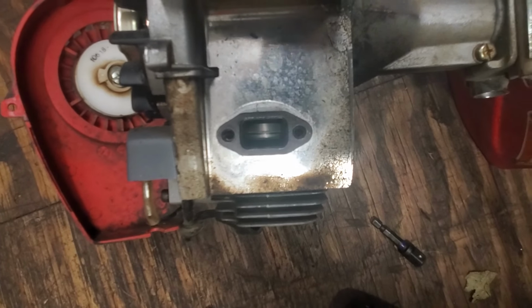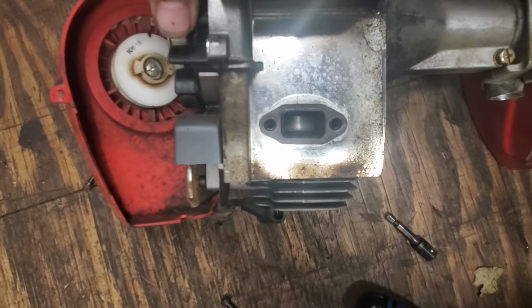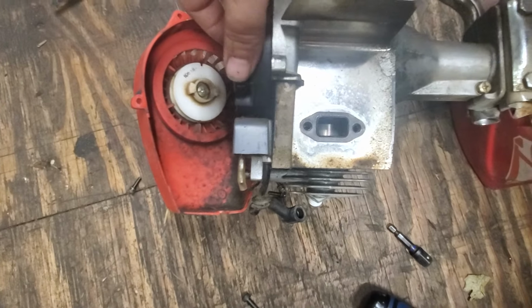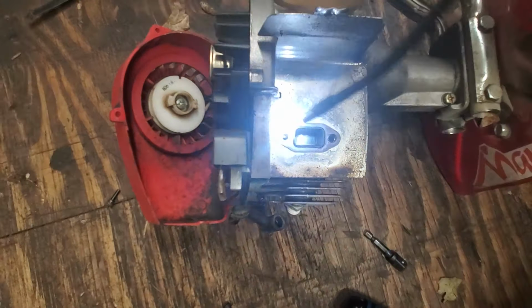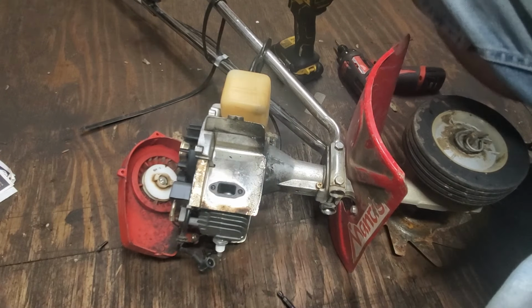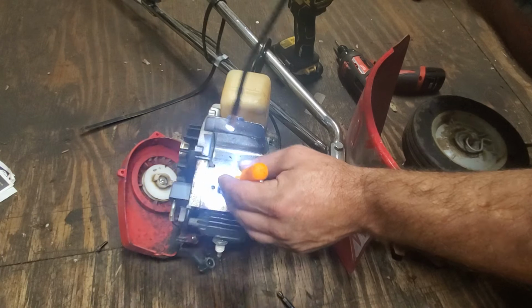Here's our piston. Okay. Let's turn this a little bit. Look at the rest of it. Methinks the piston on the exhaust side seems to be okay. I'll have to check if those are nail catchers or not. They just don't look anything major. So let's check them. Let's get a pick. And we're going to check if those lines catch a nail or not. I don't think they will. But we'll check. Don't want to waste our neighbor's money. Definitely don't catch a nail. Not at all.